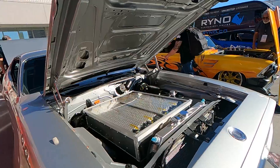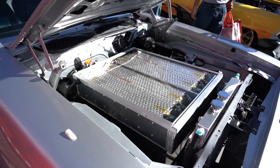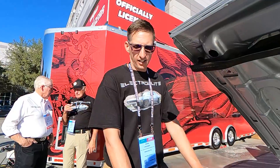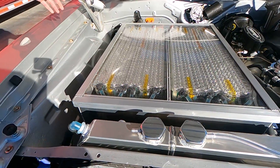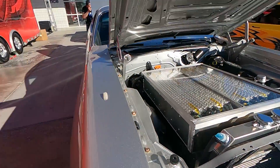So what got you into this? I was gonna do a twin turbo 1,000 horse Hemi, and one day I just wondered if I could figure out electric. We actually incorporated our battery into the frame — we have a truck so we have tons of room, so you don't have that ability here. So you physically cut the battery up? I did, yeah. I didn't know if this was a good idea, so I wanted it reversible, so everything's bolted. I didn't cut the car at all. I just took the 100 kilowatt hour Tesla Model S battery and repackaged it. I've got a box of four on top of a box of six, and there's another box of six in the trunk. So you still have the complete battery? It's a full battery.